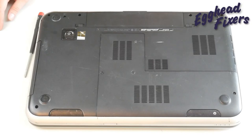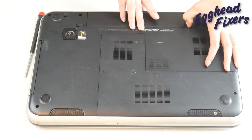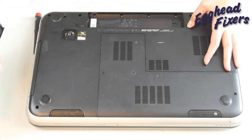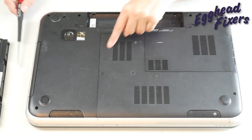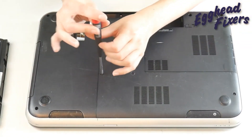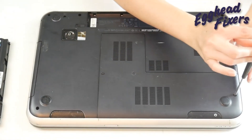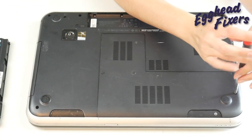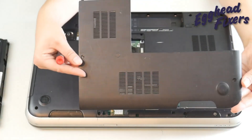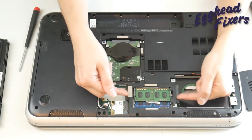We're going to show you a quick and simple way to diagnose this problem. The first thing you're going to do is turn your computer over and take the battery out. If you have an internal battery you're going to have to open up your computer to unplug it. We're going to look for an easy access panel on the bottom of your laptop. If you do not have an easy access panel, you might need to look at the disassembly video or go to your manufacturer's website to look at the service manual. What we need to get to is your memory or RAM.